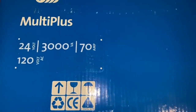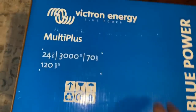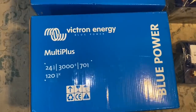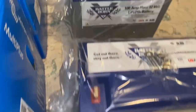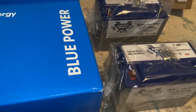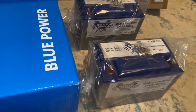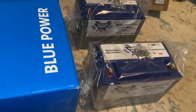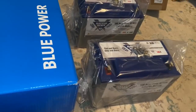I'll still be able to use all the 12 volt stuff that's on the bus currently hooked up to the house system, and the 24 volt stuff is going to power the inverters. Here's the rest of my haul — two different 3000 watt inverters. These are 24 volt from Victron, the MultiPlus. And I got a couple more Battle Born batteries. We already have 600 amp hours in there; this is going to bring us up to 800 amp hours. But by the time we go to 24 volts, we'll have 400 amp hours at 24 volts.